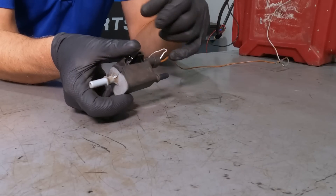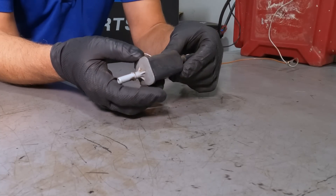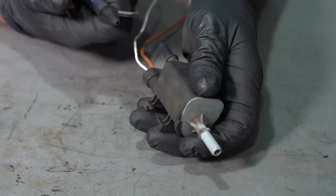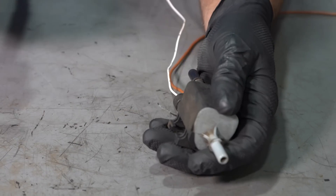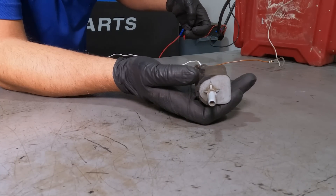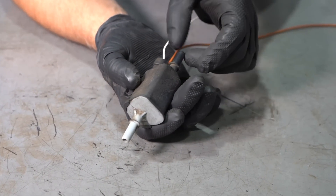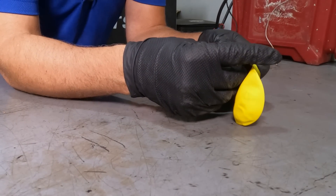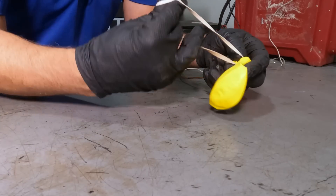Now let's do a little testing. We have the solenoid hooked up to a couple of wires — one is a power wire with a switch on it, and then a ground wire on the other side. You could take a little bit of compressed air from an air compressor, set it to a low pressure — about 20 PSI would be good — and just try one side and see if you get any airflow out the end. We don't with this system. Now if we flip the switch, you can listen and hear the solenoid clicking — that's it moving on the inside. So if you had pressurized air on one side and you clicked it, it should come out the other side. To demonstrate that, we can take a balloon very carefully and wrap a rubber band around it.